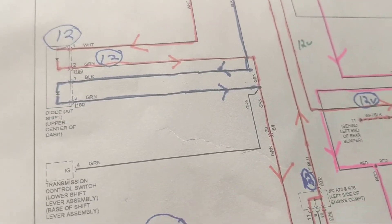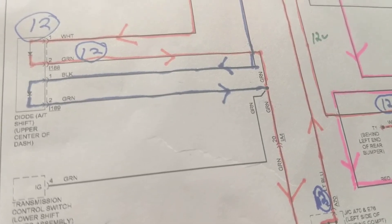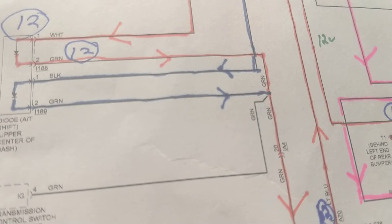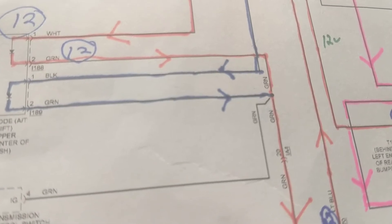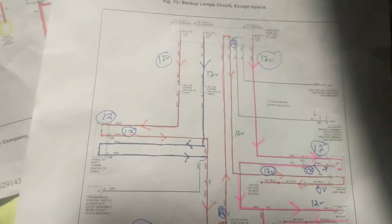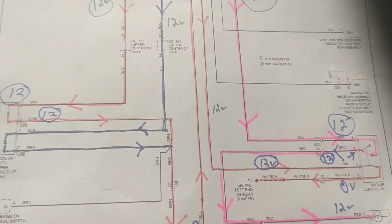What I do is pull up behind another car and put the parking lever in reverse, then use the reflection in the other car to see my reverse lights. Or I put something — like a piece of wood — on the brake pedal to hold it down, then go to the back to confirm the brake lights are on. Anyway, with Toyota Camry hybrids and modern cars it's not that easy — that's what we're dealing with here.